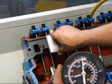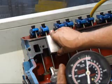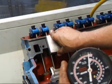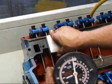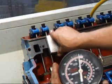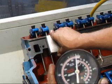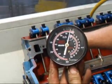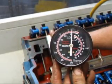The reason we have vacuum here is because our valves are opening and closing at a certain time, and the piston going up and down creates a vacuum — a suction — which we measure in inches of mercury. An engine that has good vacuum at idle will have somewhere around 17 to 18 inches of mercury. As you see here, at this very slow RPM, we're only pulling about two to three inches.